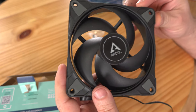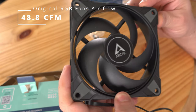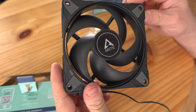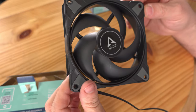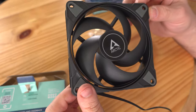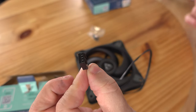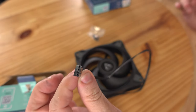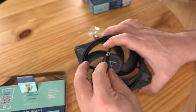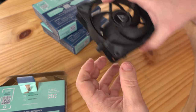Along with the higher speed comes more airflow — this delivers 81.4 CFM, while the original gave only 56.3 CFM and the RGB one gave 48.8 CFM. So it spins faster and blows more air. This one uses dual ball bearings, while the other two used fluid dynamic bearings. It has a 0.6 sone noise level versus both originals at 0.3. Since it supports variable RPMs, it is a PWM four-pin fan header, though it will work on a three-pin at full 3300 RPM unless you change the voltage.